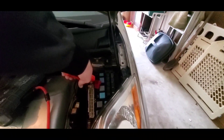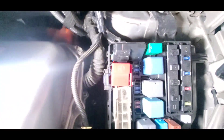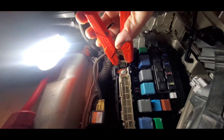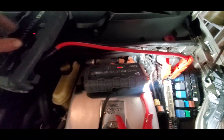But I know that I don't, because I've got my positive over here. This little thing is supposed to pivot off of here — I've got my positive right here at the fuse panel where it's supposed to be. This little thing pivots up and then the bare metal under here, this bolt on this piece is what you hook your positive to. So I've hooked it there and then I've hooked my negative to the bare metal of the engine block. Any bare metal should do, but it's saying that we have it hooked up backwards. So I'm going to try to use the GB70 box and see if that works better.